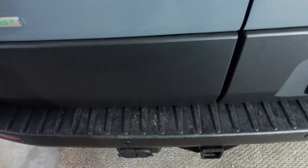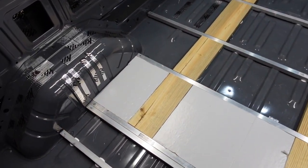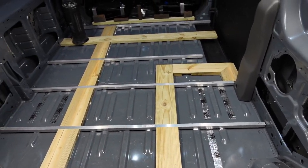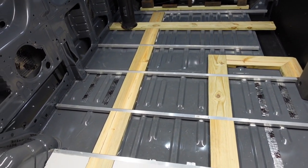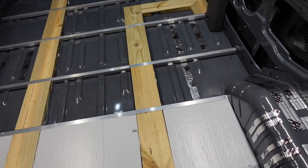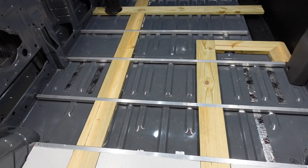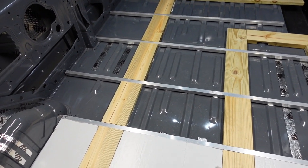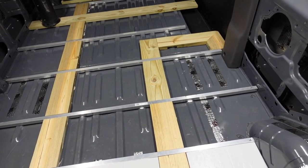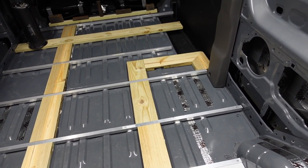Let's go in the back of the van - you can see what we've started. This is how it goes in, fairly straightforward. You can see the one by aluminum tube and then the planed-down treated lumber, which is again going to be the base for our cabinets. You could screw through right into the one by aluminum, but I think this gives me a little better mounting, a little better bite than screwing straight into the aluminum.